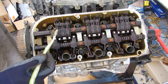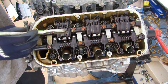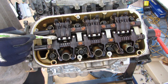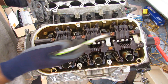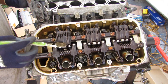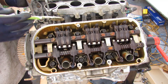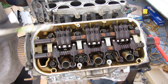Looking at the intake side is where things get interesting. With VTEC you now have three rocker arms and two valves for the intake side of each cylinder. The two outside valves handle normal daily driving, following a typical cam profile that opens and closes the valve at a preset height — good for economy and reduced pollution. However, when you step on it and want more power, VTEC kicks on, enabling the middle rockers which follow a taller cam profile, allowing the valves to open higher for more air into the engine.